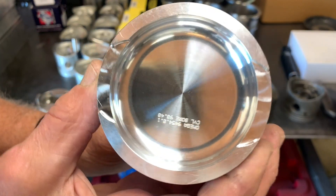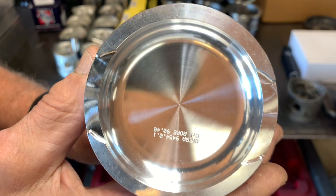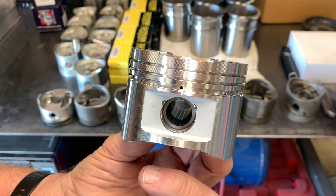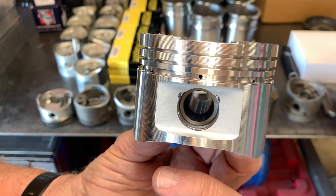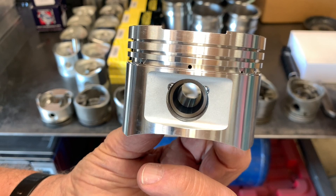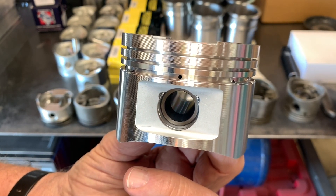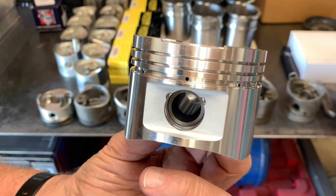I've got to do a little research to determine which way these pistons go in the cylinder. The piston pin offset thing isn't a big deal, it's just that the timing index on the bottom of the front cover is not going to be much help without modifying it a bit so the engine can be timed. I learned this on my track car where I had no offset on those pistons — I actually had to cut and move it quite a bit to get the zero on the index on the harmonic dampener while the piston was at top dead center.